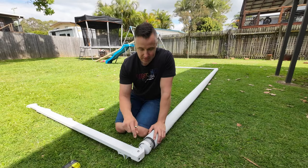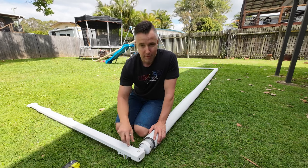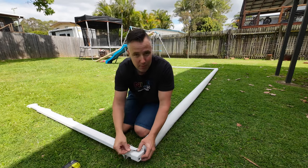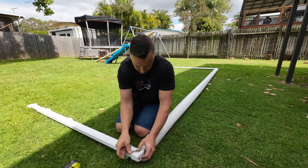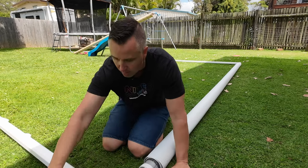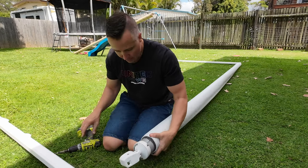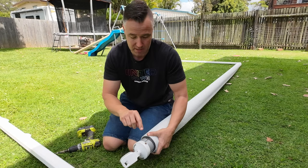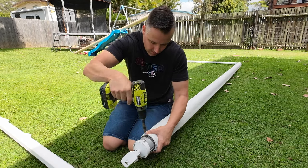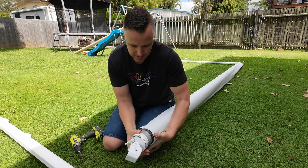On the arm itself we need to unbolt the spring spline away from the arm. This one takes an 11mm — we'll undo that and then remove the arm. Some tubes may have a rivet holding the end in the spring, but in this case it looks like it's been replaced before and it has a square drive, so we simply unscrew those on both sides and remove the spring.